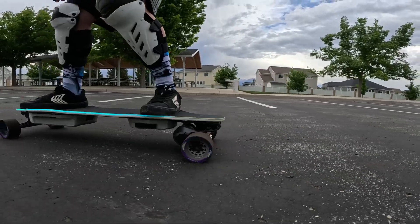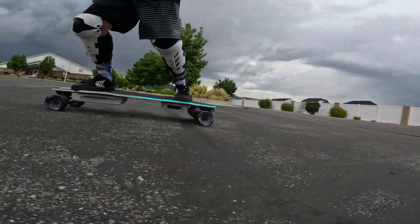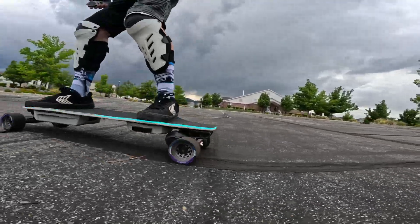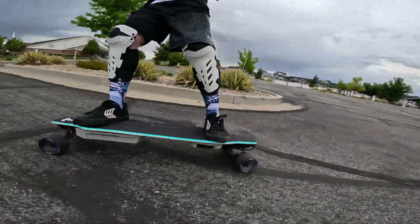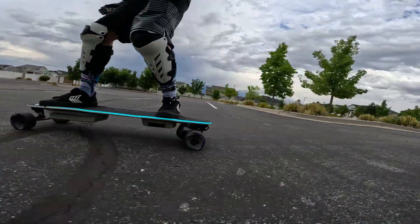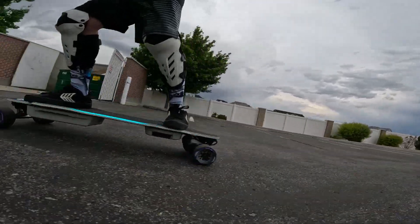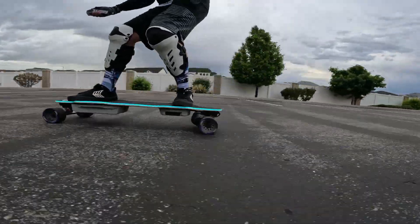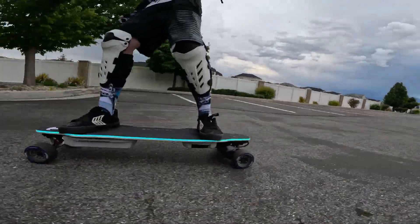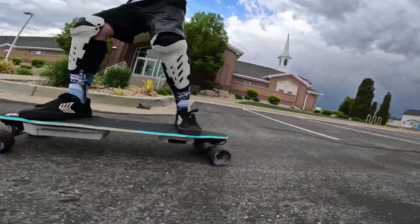As a notable highlight, the braking on this board still has issues. In my initial review, I thought this was caused by skipping belts because they were a little loose, but after trying tighter belts I'm pretty sure that's not the cause. The wheels still lock up when applying maximum braking power — when turning the braking knob all the way back. Most people will probably never turn the braking knobs all the way back, but it is good to know how your board behaves at the extreme ends of the performance curve. When an emergency happens, such as when a car pulls out in front of you, you'll know exactly how your board behaves if you choose to slam on your brakes — it might save your life. After testing belts, I tested changing the wheels, which also did not help. After ruling out wheels and belts, there is only one thing left: excessive motor force when braking. This just means the motor locks up prematurely when executing a hard stop.